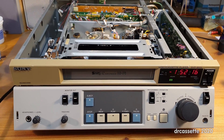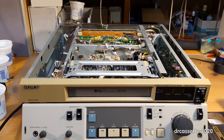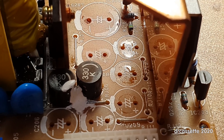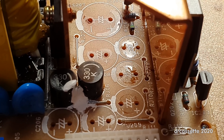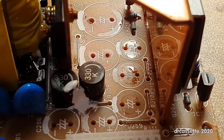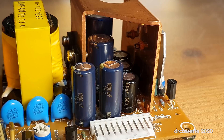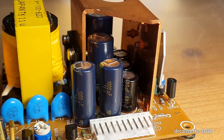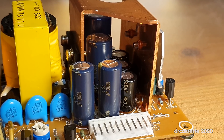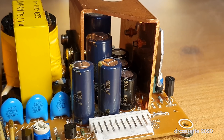Let's press eject, get out the cassette, and turn this off. Now I can replace the secondary side filter capacitors. Notice how the circuit board looks wet in the places of the old secondary side filter capacitors — that's all electrolyte that has leaked out. They're all Nichicon and they're all bad. I cleaned the board with isopropyl alcohol to get rid of the electrolyte. The new secondary side filter capacitors are installed — all 105°C rated like the originals, but on some of them I was able to bump up the voltage rating from 10 volts to 16 volts, giving them a little more headroom.